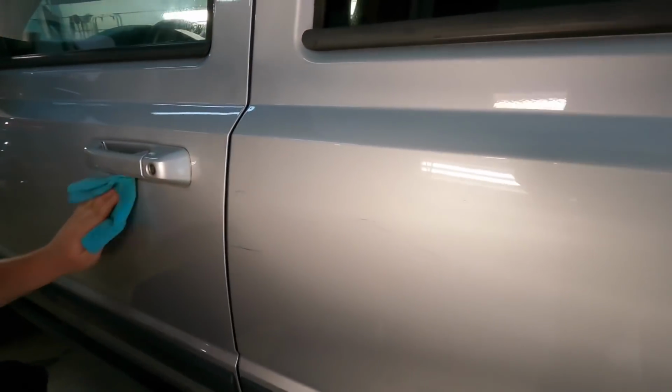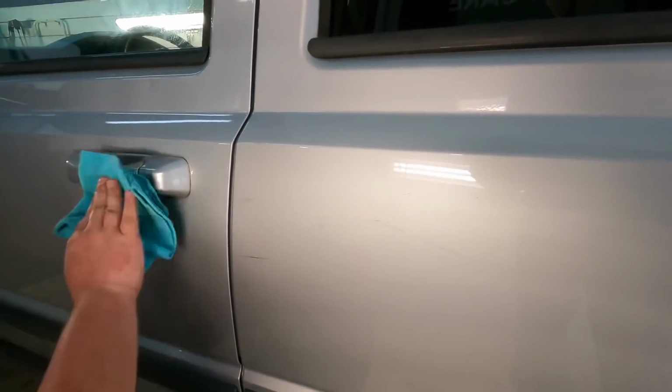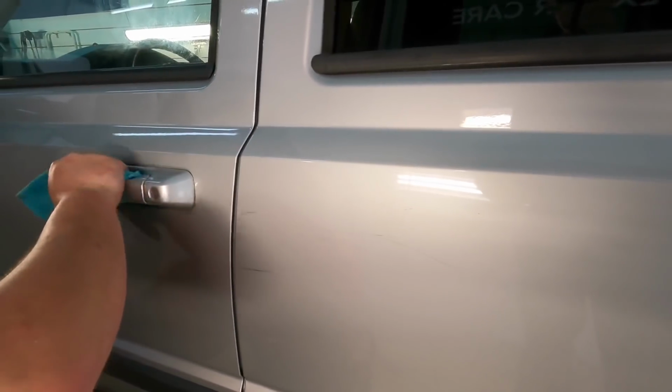It's where something got up against the vehicle on just about all sides and transferred its color or material onto the paint. You can use any type of substance to remove it, anything from Citral 266 to Goof Off. Really, we didn't get aggressive. We just sprayed a little bit of Citral 266 into a microfiber, and with very little effort at all, it was removed. A little bit of scuffing behind the transfer, but the correction and the polishing will take care of that.